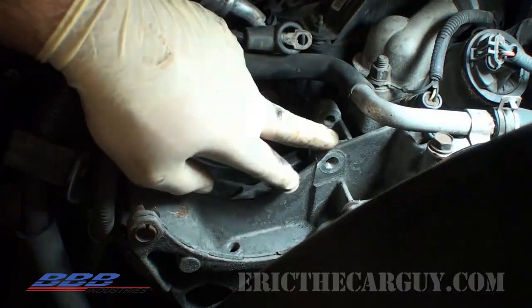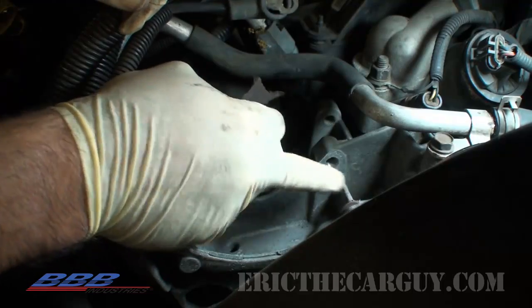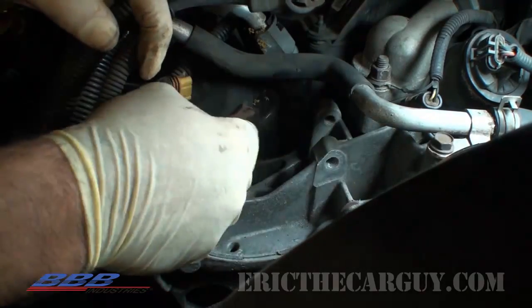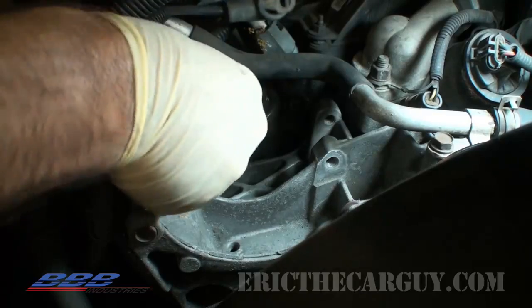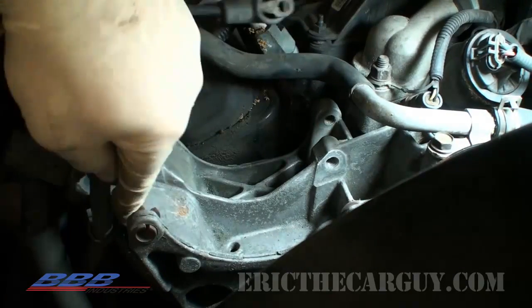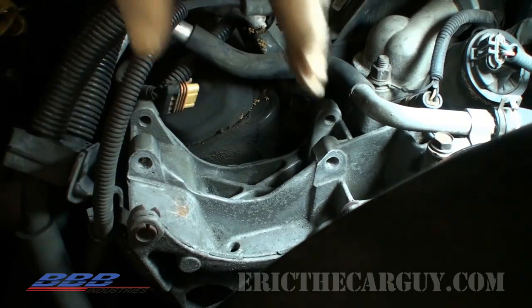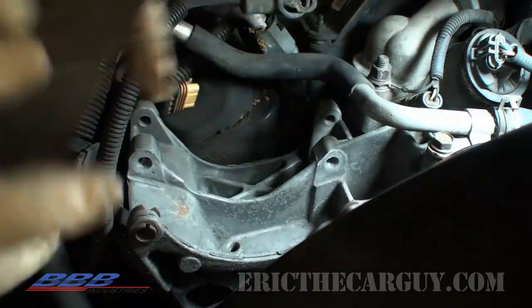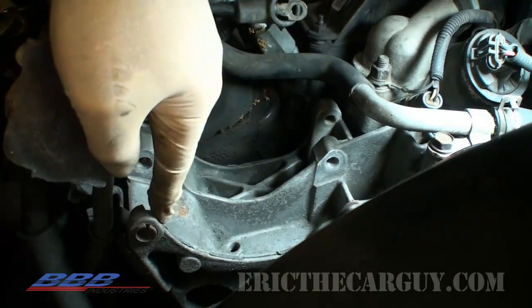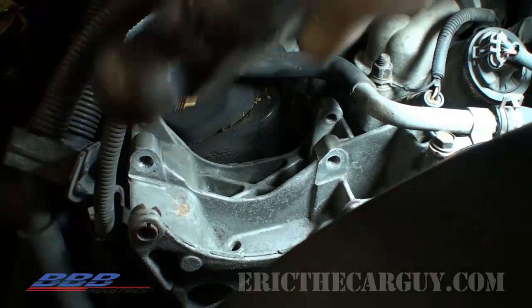Before we go and install the new alternator on the bracket, I'm going to take a little piece of sandpaper and just clean up the mounting surfaces, because this is actually the ground circuit for the alternator itself. So just give those a quick little shoe shine so that your alternator will be able to work its best. I'm also going to take these little sleeves — there are actually two of them — and just knock them forward just a little bit. That'll make dropping the new alternator down in much easier instead of trying to hammer it in. You don't have to move these much — just a millimeter or two will give you enough clearance. When you tighten the bolts down, it'll draw itself back up again.